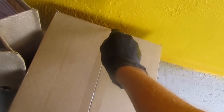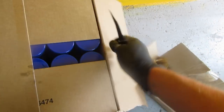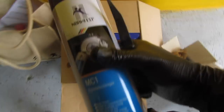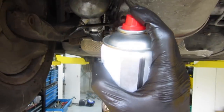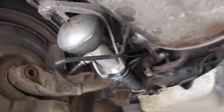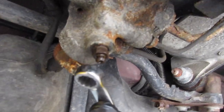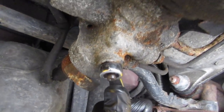Now we're not done just yet. We're going to grab a can of brake cleaner and go on a bit of a cleaning spree — just brake cleaner — so the MOT man knows that we fitted a new part. Now that we have our new ram fitted, we're going to start the bleeding procedure. Remember the bleed nipple — we need to make sure that is tight. Don't overdo it, just make sure the fluid's not going to come out.